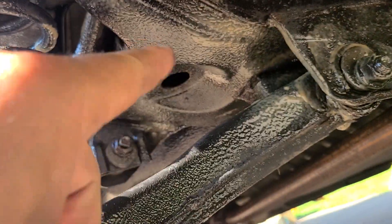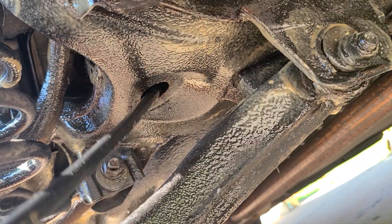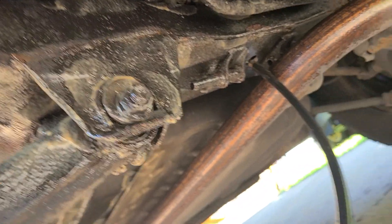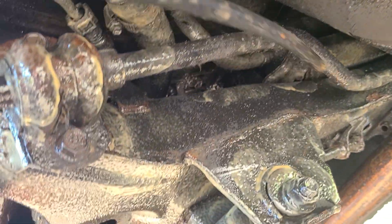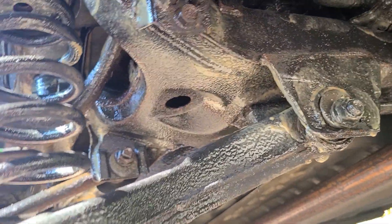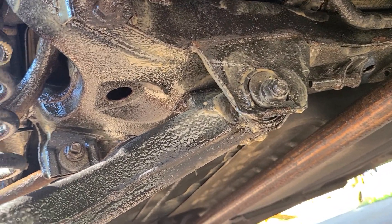You want to get down and as you can see, all this is coated. But you want to take your wands — there are several spots on here that you go in. You go in here, you go all around. You go up in here, you go in the middle, you go from both sides. You get all around the gas tank. You get around the evap canister, which is up here. You get around this hole — this is your subframe. You don't want that to rot out because they can fail your car for that. You can buy a new one, but why, if you can protect it?